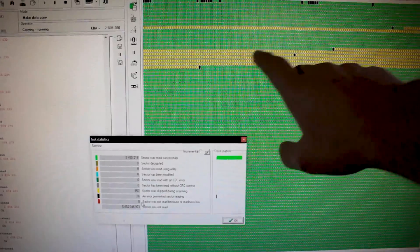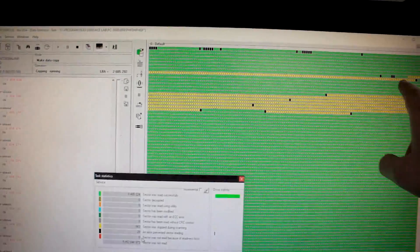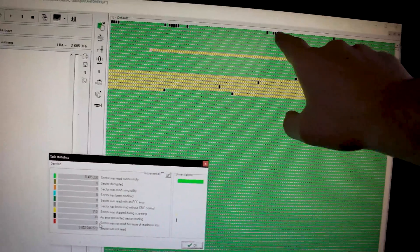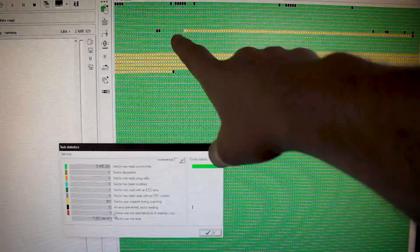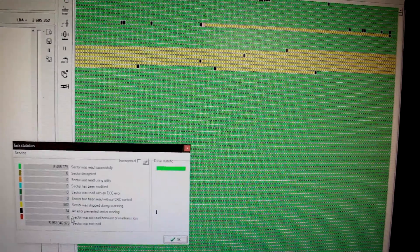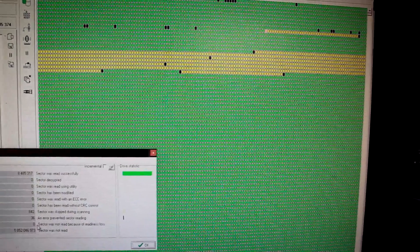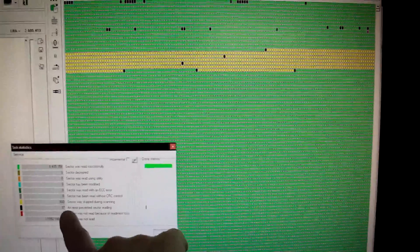I went back to re-read those bad areas. I limited the block size to one — now we got 949. So it's reading some of these ones. It seems like the only problem was the beginning of the drive. It's correcting them right now and we're going to have a few that did not read. I also changed the timer procedure and the error handling. Hopefully this will be good enough. We'll leave it running and see what the total number is when it's finished.